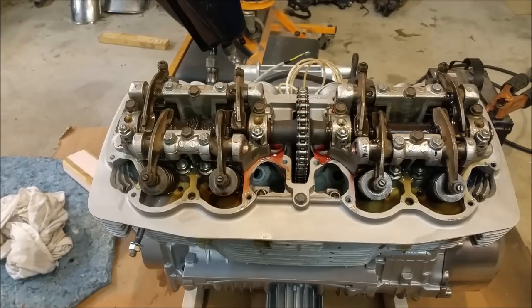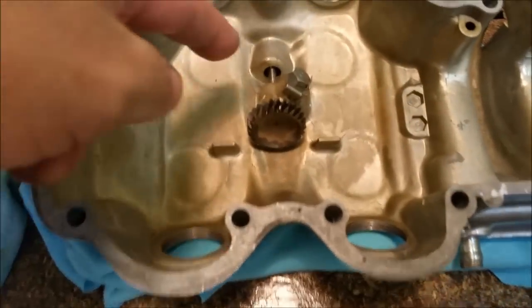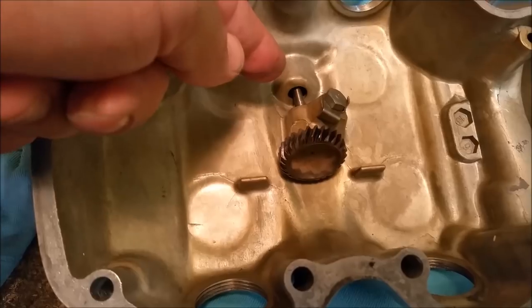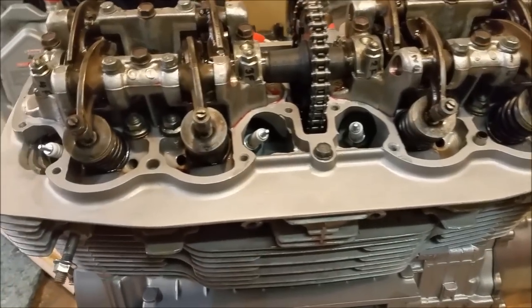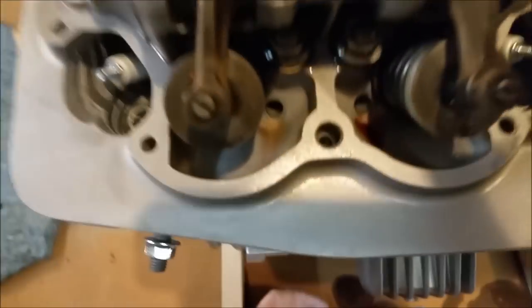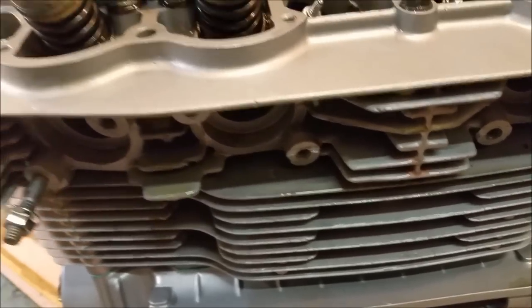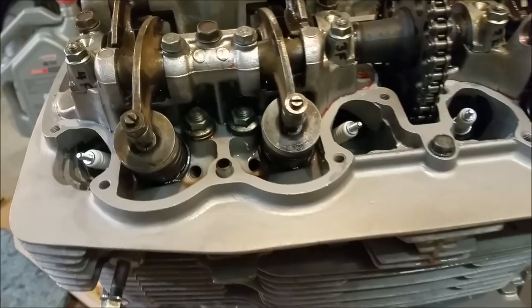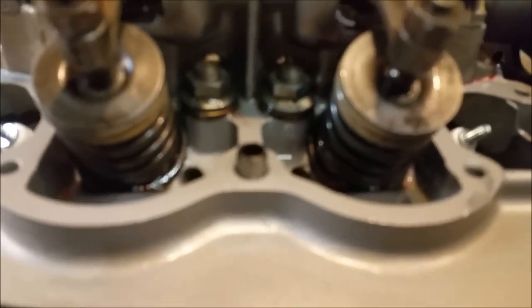Don't think for a minute that the moment you put a dry pump in, everything's going to be alright. You do have to prime pumps and muck around a bit. I didn't prime it, but I did mess around a bit. I didn't film the seal replacement here — it's just a matter of taking that 6mm bolt out and that whole gear will come out. The seal sits in the base here in quite a long channel. Now I made a really easy rookie mistake: when we oil pressure tested this, I didn't block up these holes. Oil came out of the cam box and went straight in there through a small hole, getting oil all over the place. No big deal to clean up, but it's a lot easier to just pop those locating dowels in — the oil just drips off cleanly. Make sure when you do your oil pressure test you put those little guys in, because they'll save you cleaning time.